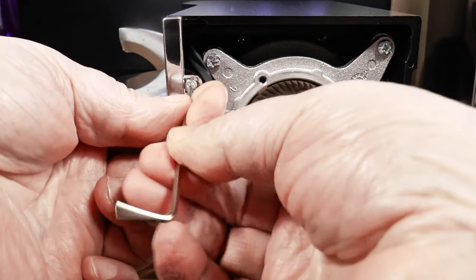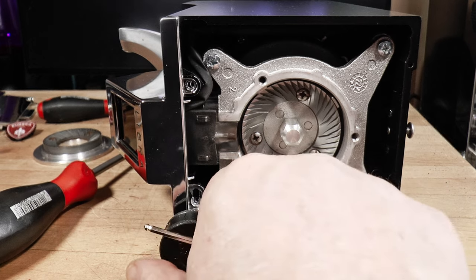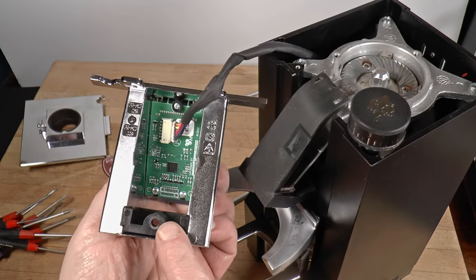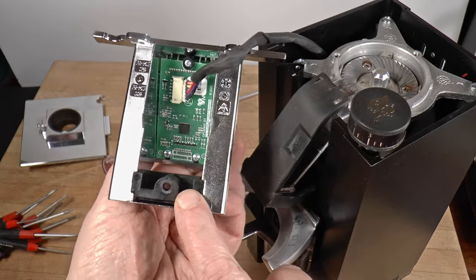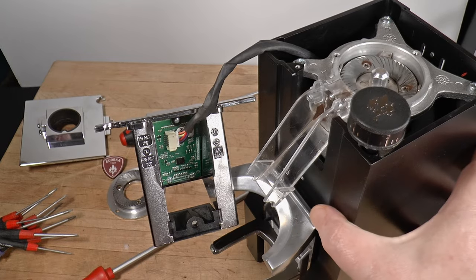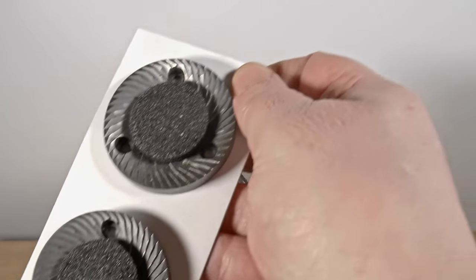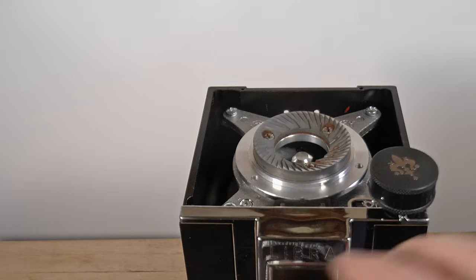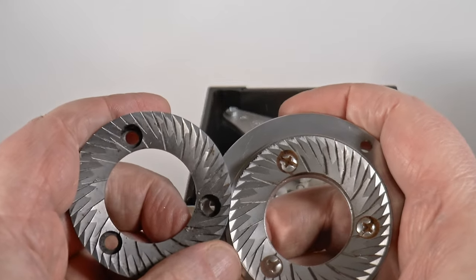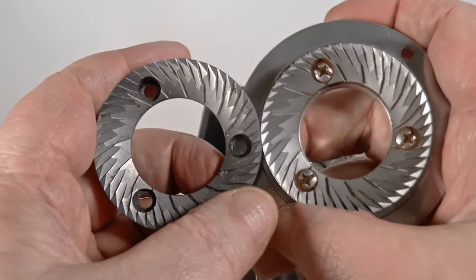The front panel is held with two Allen screws, and a small key is included. If the knob is in your way, just unscrew it and it will come away completely. The chute and elephant's trunk have been redesigned slightly for much better sealing and noticeably less friction. Look at how clean it is outside the grind chamber — this is why you get very high dosing accuracy and consistency. We have the same 55mm burrs used in the Specialita with 16 small breakers. These produce relatively fewer fines than some espresso grinders, creating a somewhat cleaner flavor profile that a lot of people like.